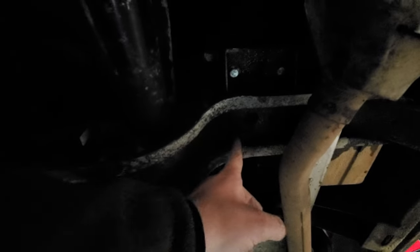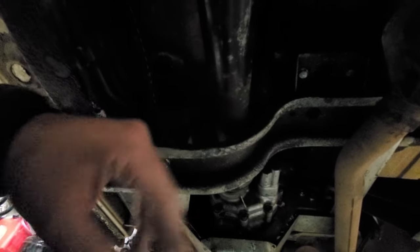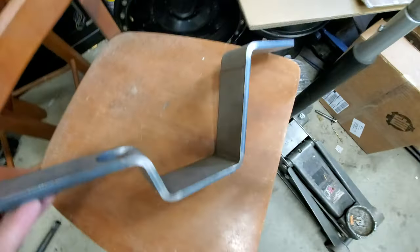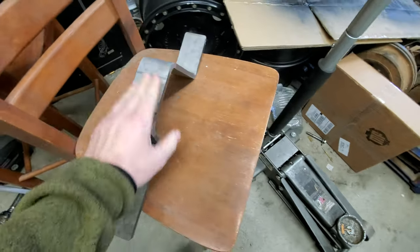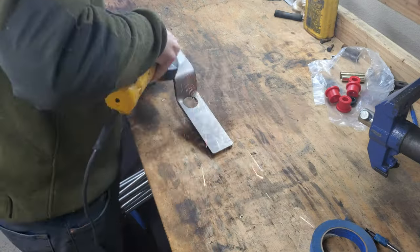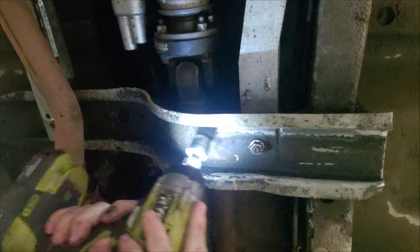So what we're going to do today is cut this piece out. There's a bolt right here we need to access and a bunch of metal we need to clean up. We're going to cut it right here and here, and put a big drop bracket in there to give the drive shaft more room to move. This is half-inch steel bent to shape — it's got a little cut-out so you can still access the bolt. It's super beefy and pretty clean. I'm going to take a flap wheel and smooth up the edges to get nice bare metal for good weld contact, and we should get a ton of clearance from this.